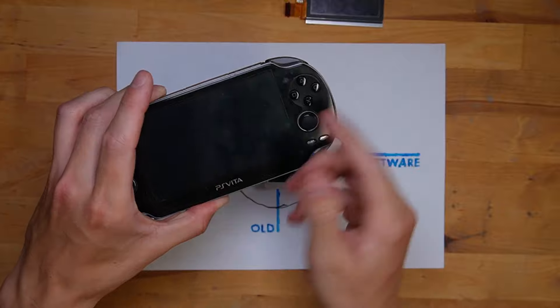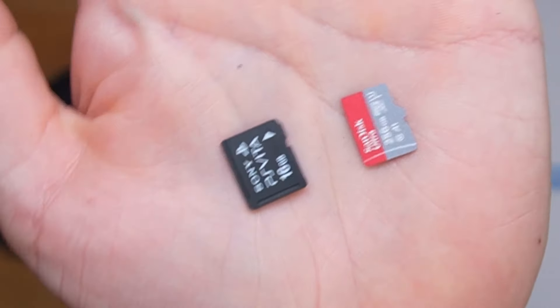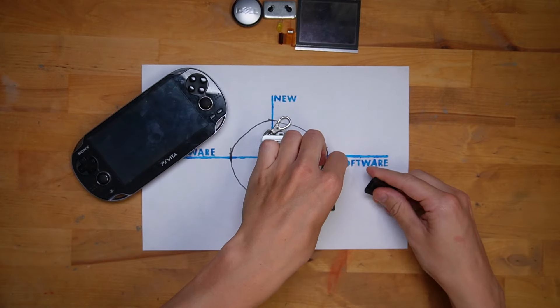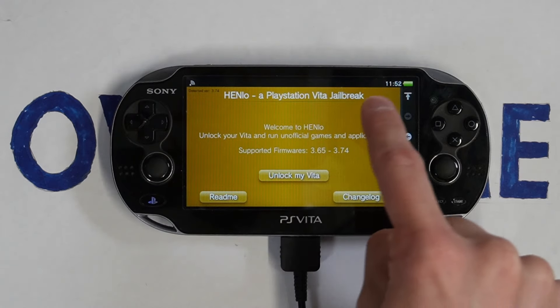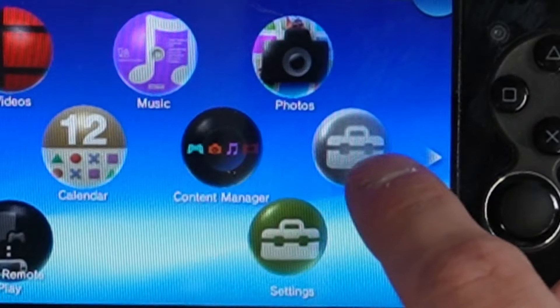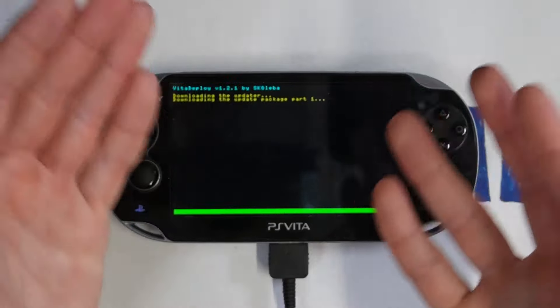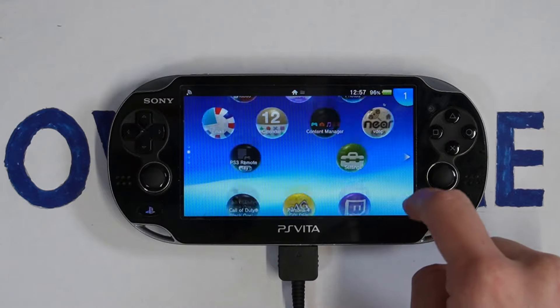But there was another thing that really bothered me about this thing — the proprietary storage, which as you can see is very similar to microSD cards, but just not it. Now, there is a way to put microSD cards into your PS Vita, which is by using one of these adapters in which you can put your microSD card and put that into the game slot of your PS Vita. However, Sony didn't officially support putting extra storage in the game slot of your Vita. So if you want this to work, we need to adjust a little bit about the software of the PS Vita. First off, we need to go to a website that allows us to install software which makes us run custom programs on the Vita. Then we can create a separate area on the memory stick of the Vita where we install a brand new PS Vita operating system that basically just gives us all the free reign to do whatever we want. And then finally, we can go and put the adapter in, format it, copy all of our data over, and bada bing, bada boom, we are done.